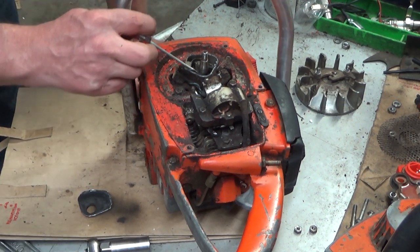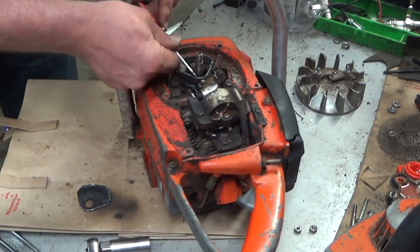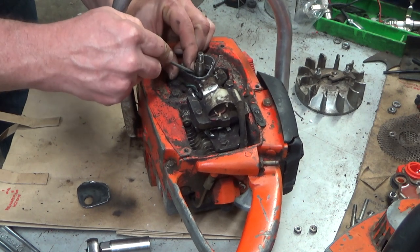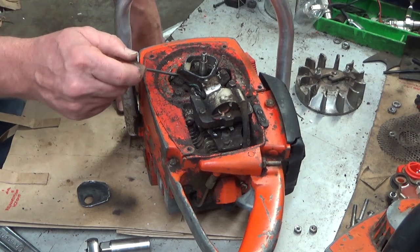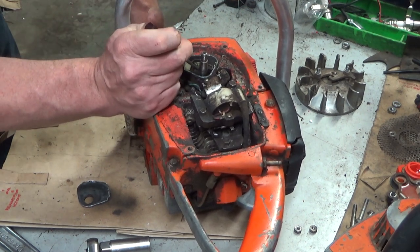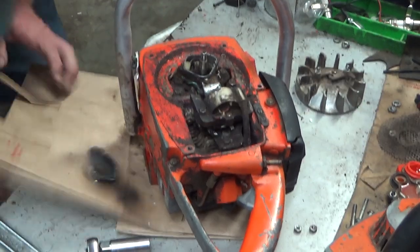There's a bunch of material wrapped around the crankshaft here. This is odd — I've never seen this. I think that's the felt just — yeah, the felt got ripped and pulled around there. I'm gonna say the crankshaft seal was leaking over here too. It doesn't look like the points were necessarily damaged, so that's good news. You can see the condenser is destroyed — that thing sat there and beat against the back of the flywheel.